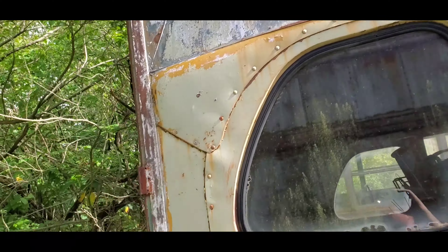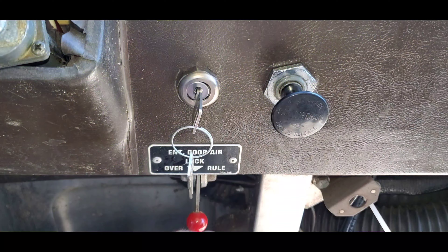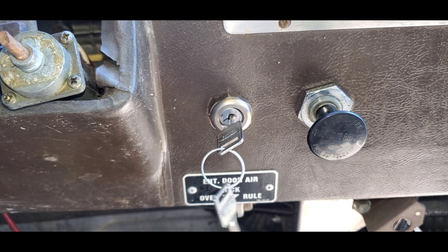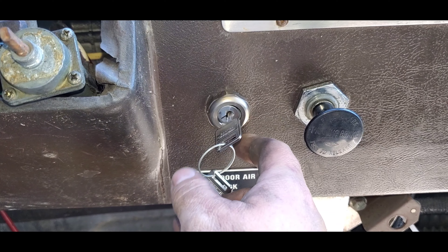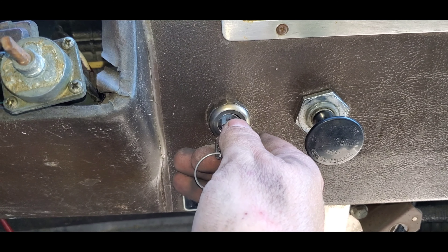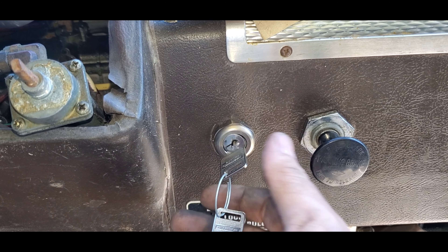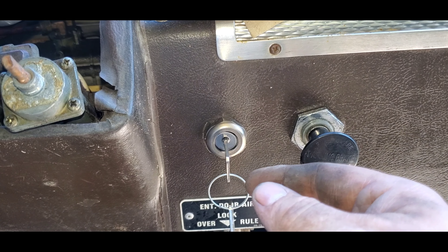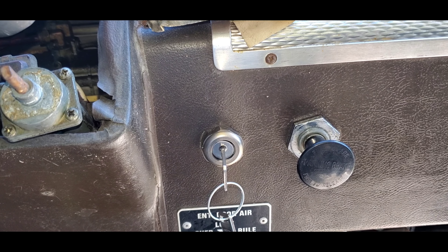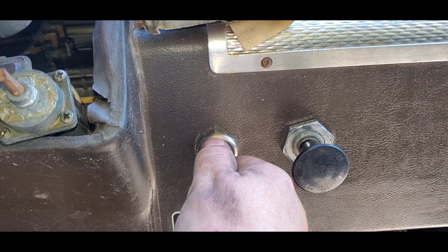Now back to my wiring on the bus. Doing a 12 volt conversion — you can hear that's my accessory relay clicking. One thing I didn't think about: when you turn this to the start position — getting rid of the push button by the way — it kills the accessory relay off. Accessory relay comes off on accessory and start. I don't think that's going to work because it's going to kill voltage to the skinner valves, which will in turn shut the fuel off while I'm trying to start it. I might have to switch all that to the ignition side of this switch instead of the accessory side.